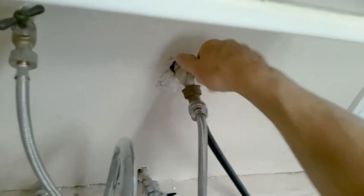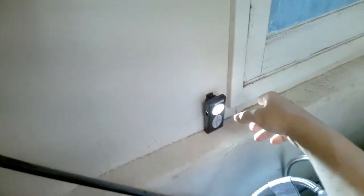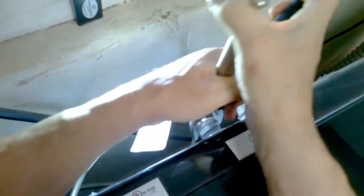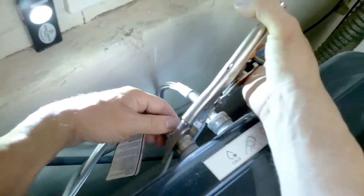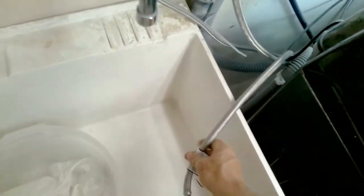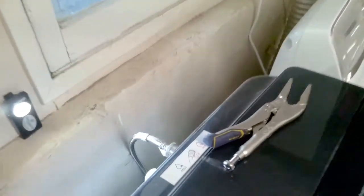What you want to do is turn the water off and remove the hose from the inlet valve. In this case on this washer there was some type of orange material that was not allowing the water to enter the tub.